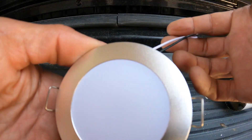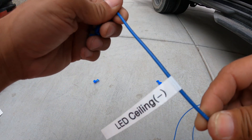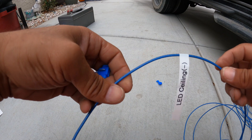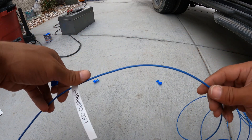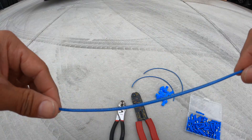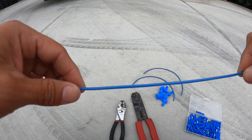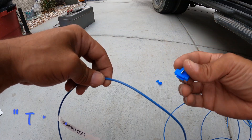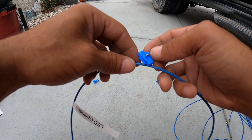We used our label maker to label our wire - this is going to be our negative one. This wire runs from the furthest LED all the way back to our fuse block. Along the way we'll tap into it to hook up the other LEDs. We have 12 LEDs total, so this is one main wire running through the ceiling. An easy way to splice into these lines is to use these little splice connectors, made for 14 gauge wire.